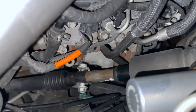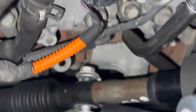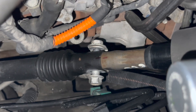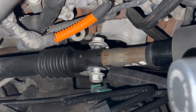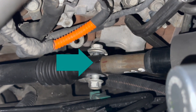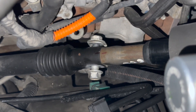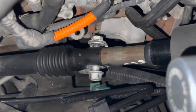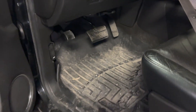On the driver's side I'm loosening up the bolts — it's a 16 millimeter for the bolt on the engine side, and there's a locking tab making it super easy since it's not torqued down too much. You can also see where I marked the shaft with a little red sharpie to keep orientation — anytime I'm messing with steering components I always mark orientation, just to be on the safe side. Let's pull that bolt out and move on to the interior side.